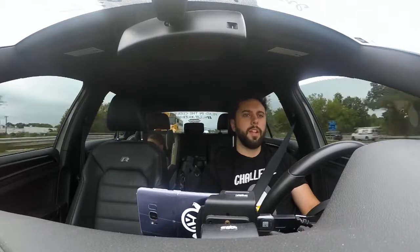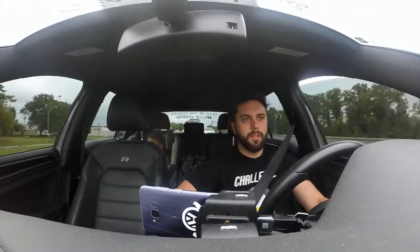Basically what I do is I'll start from a stop at a stoplight or something. Obviously you want to be first in line. And then I'll just kind of granny shift through 1st and 2nd, and then shift into 3rd. Probably down around 2,000 RPMs I'll be in 3rd, and then just gradually increase the throttle until I get to about 3,500 RPMs, and then mash it, so I won't get kicked down. Mash it down and then blow all the way through 3rd.